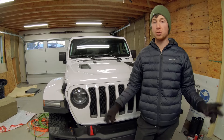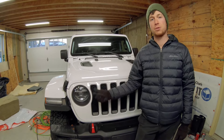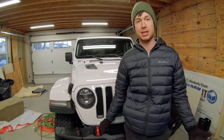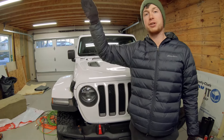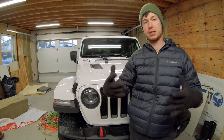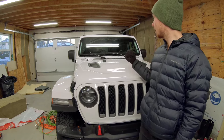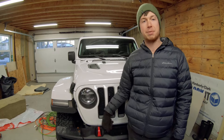As Lisa alluded to, a lot of garage doors have rolling codes. That's so that you can't simply have a repeater and someone can sit out there and steal your code and then use that repeater to break into your garage. Our garage door opener is literally brand new, so I thought maybe newer ones had rolling codes, but that doesn't seem to be the case. But in the event that you have a rolling garage door, what you need to do is find the learn button on your opener, either up on the ceiling or on the wall like ours. You push that learn button and put the garage door into learn mode, then press the button in your Jeep to repeat that code. The garage door opener can grab that code so that your Jeep can use your garage door opener securely, like your regular pendant could too.